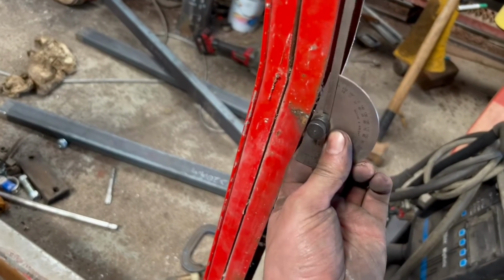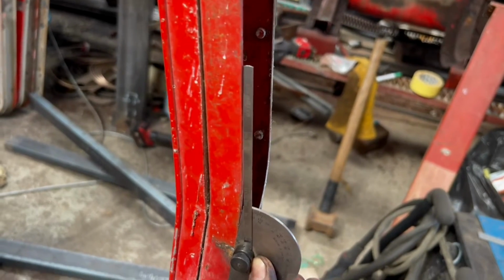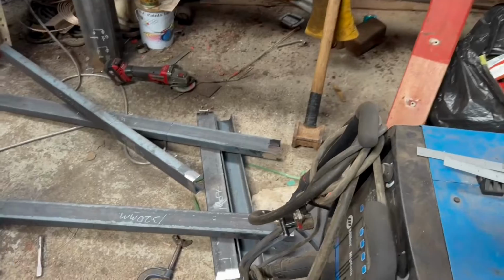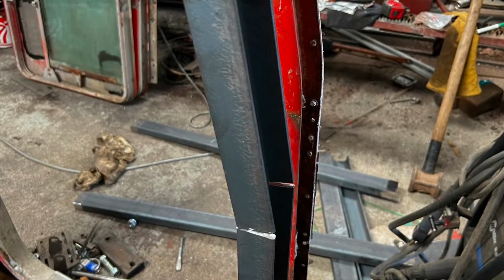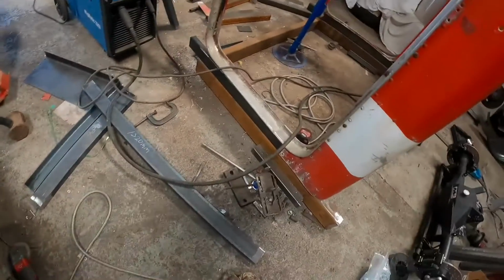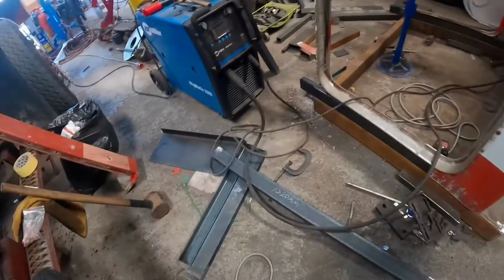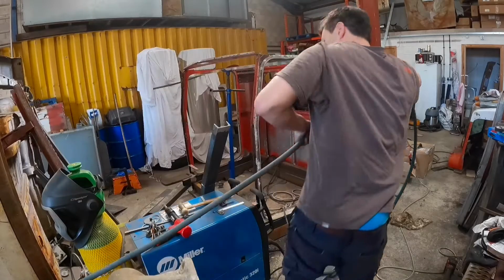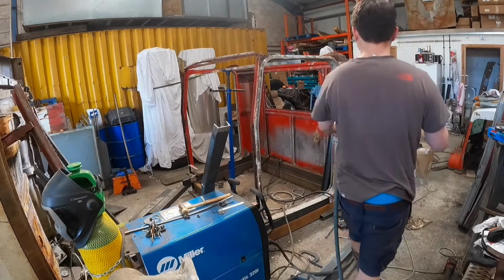But anyway, cut everything, measure the angle on the original, and when I slice the new steel across the edge and then smack it over the anvil, you end up with this, so it's close. I did fine tune the angle before welding it fully, and just made sure it matched the protractor. But we're going to get the air hammer out now and take all the horrid hucks out the rear so I can pull the skin off.